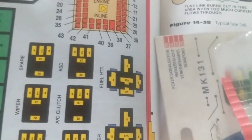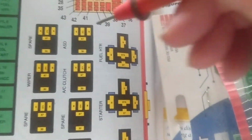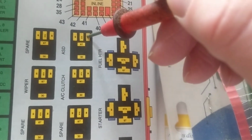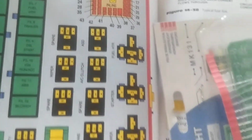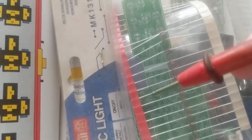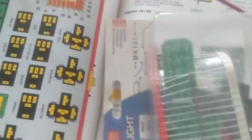No sense whatsoever. So, like I said, we're going to take this resistor, whatever it is, stick it in here, put the relay on top of it, exposing the wire. So I extended the extension from this terminal to the outside. Now I just put my probe to this here or here, and I'll measure the voltages. This is thin enough. It won't break, as you'll see, like a solder or a stripped wire. A stripped wire has strands. It'll break. This will not break. And it can be bent just in case I'm in a crowded area over here.